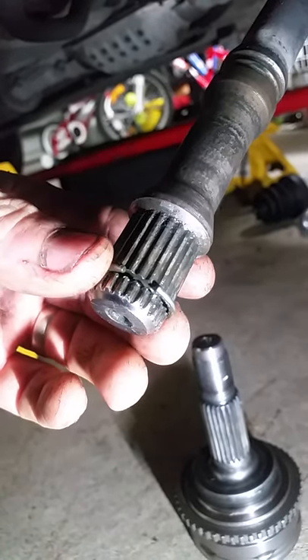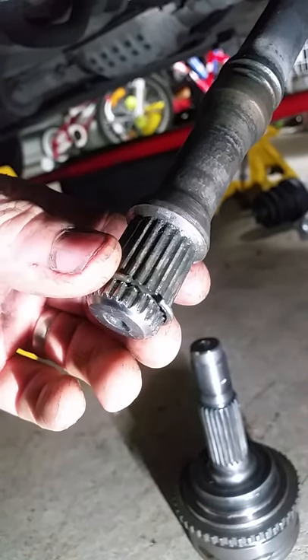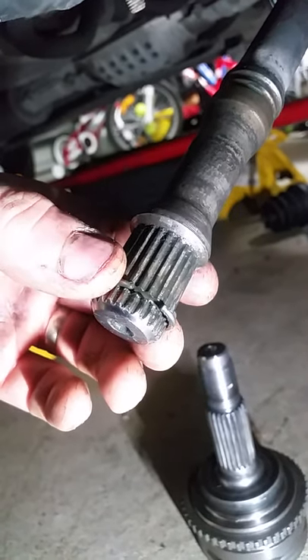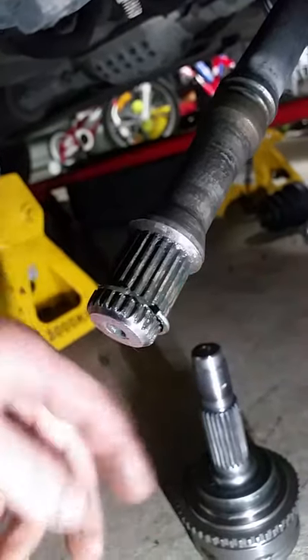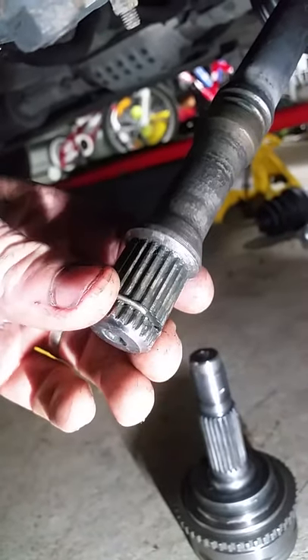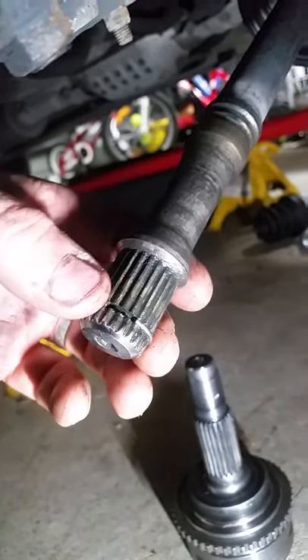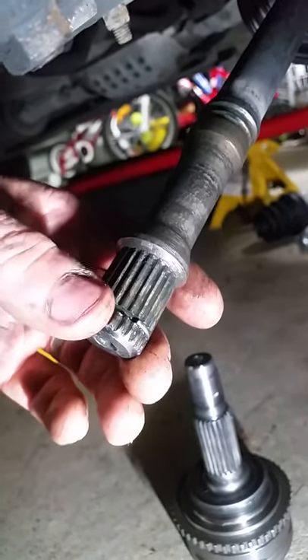Hitting on the old CV, the old clip moves to the side and damages the spline, bringing you to the point of just about losing your shirt. You can just put a zip tie around the clip — one hit should normally do it. But before you do that, if you have damaged the spline, get a file and clean it all up.